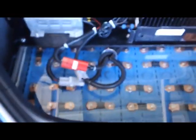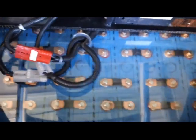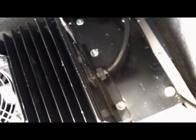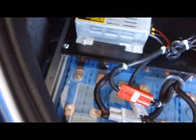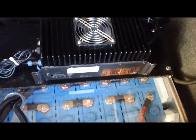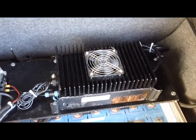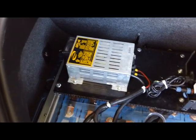Now here's the completed rear of the car. What you're looking at is 36 lithium-ion batteries in a riveted aluminum box. I cut out the bottom of the VW, sunk the box down, and riveted it to the body. On top of that is an aluminum honeycomb shelf — aircraft metal, very light and very stiff. I put the charger and the DC-to-DC converter on top of that shelf.